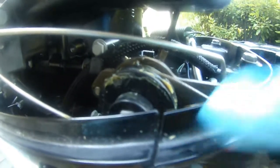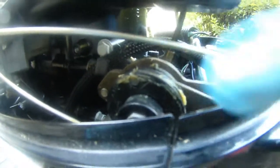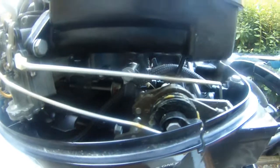Let's see what clicked. See that? This pulley actually — now I just turn it back to neutral. So this is neutral, and this is a closer look of how the shift of this four-cycle, four-stroke motor works. Anyway, so I turn counterclockwise to forward and you just saw this pulley turn 90 degrees. This pulley just turned 90 degrees, and that pulls this handle here to change the gear to forward. Let me do it again.